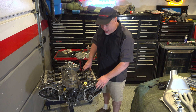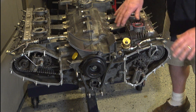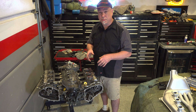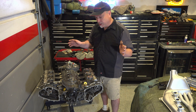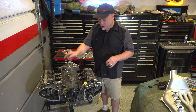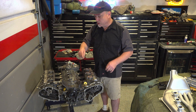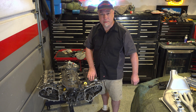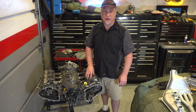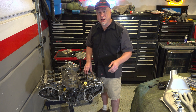That went around pretty good. Got the hydraulic tensioner lines in — had to bend those around a little bit. I left the covers off because I want to get it to top dead center with the pistons all the way up on the power stroke, so when I slip the distributor in I can aim it at number one with no guessing. I'll rotate it until I see the intake valve coming down through 360 degrees — that's my power stroke. Next week we're going to be at the bench trying to figure out if I need to rebuild that fuel distributor. If you get anything out of this, give me a like and subscribe.